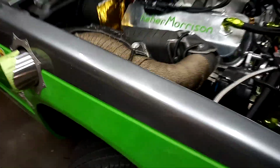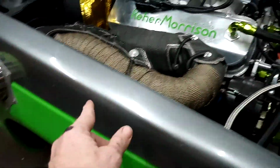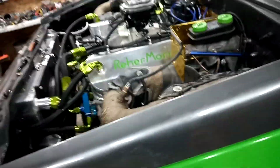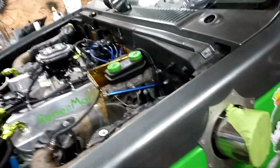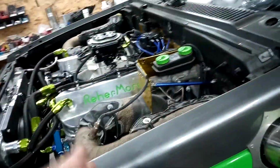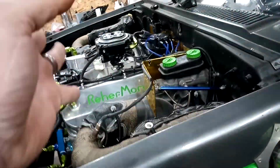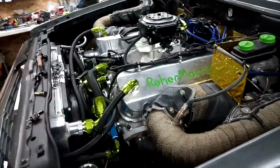I got to get the front tires mounted up and get them on. I'll take them up and get them balanced, because all I got is a bubble balancer. I don't have a spin balancer. And get them on. We're going to get it running. Then I'll worry about doing the spindles, the lower tubular control arms, and all the little bitty stuff. I want to get this thing where it'll run. This engine has been sitting since February, so it's time it fired up and ran.